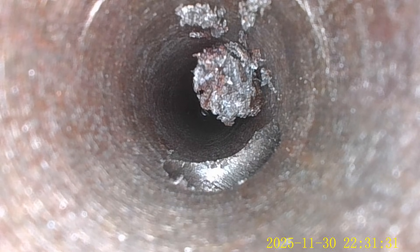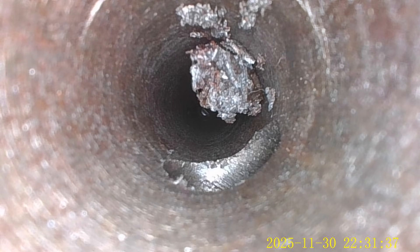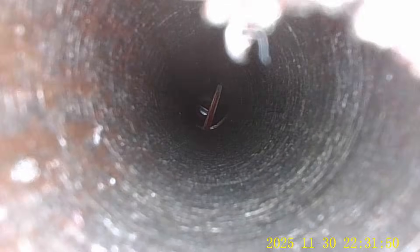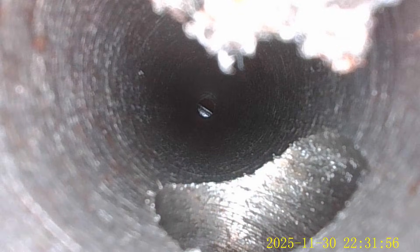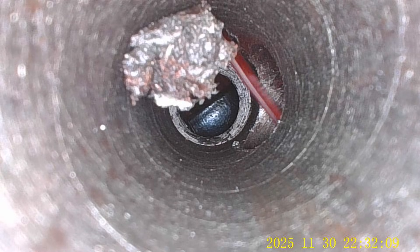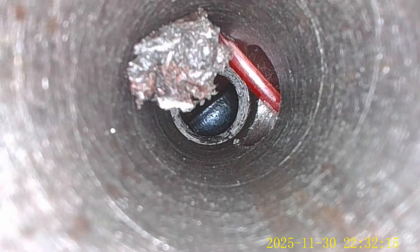It's still hard — it's like not drilled all the way. So we'll see now: it'll feed that main bearing and then it'll go back around and feed the cam from the same journal. There's the next one — that's four right there. We'll get through that stuff and there's the fifth main bearing right there. That's some of the stuff I had pushed out before. Now when it goes and feeds that main, it goes around and feeds the cam bearing.